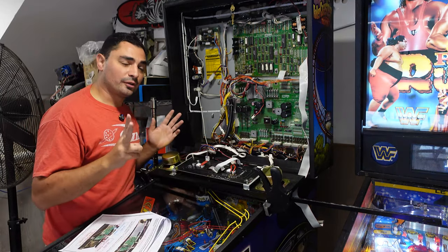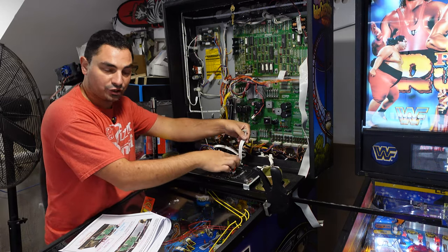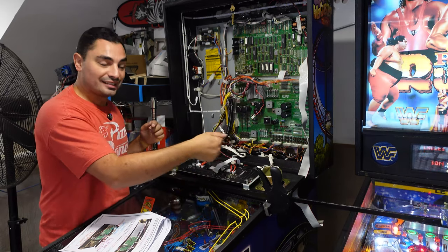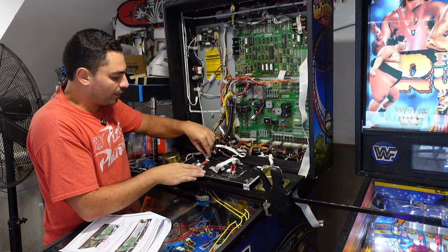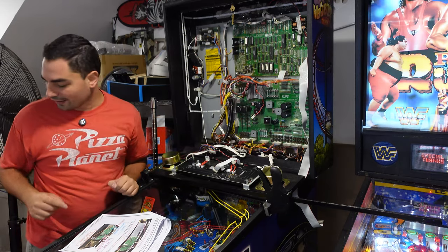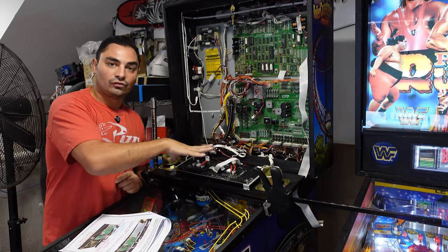All right, cool, so two cables get plugged in here at this point. We have that 14-pin ribbon cable. It's kind of small. That gets plugged in. Make sure the red line is closer to the center. And then you have here from the new cable they send, it is labeled Pin2DMD power input. That goes into the four-pin Molex. And now we're gonna bring back that metal plate right on top.